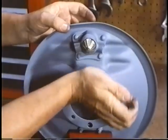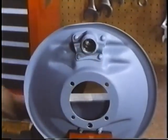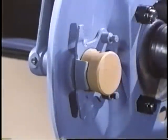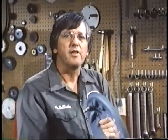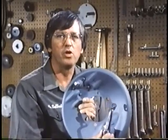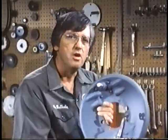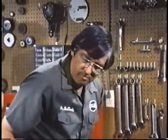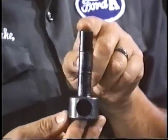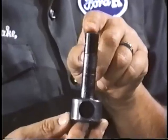With the backing plates restored, we are now ready to work on all the moving parts. The first thing to move in this mechanism is the rear brake camshaft. By grinding, punching, drilling, pulling, and gritting our teeth, we can remove the lever and then remove the camshaft. It probably will be worn. We can either have the old shaft built up with weld and turned back to the original size, or we can replace it with a new camshaft.